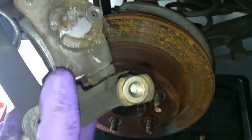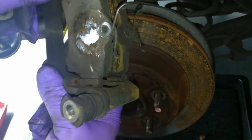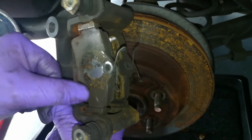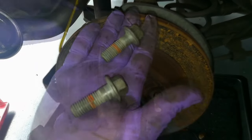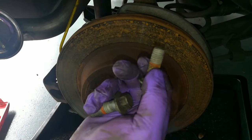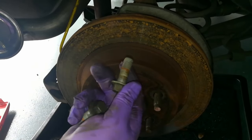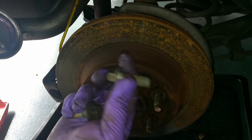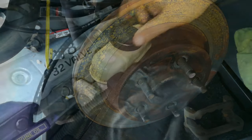You can see that each one of the brake pads back here actually has the hardware attached on the upper side and the lower side, so you want to make sure you put this back in the same exact orientation. Here are your bolts that hold the caliper bracket in place. If you're not very familiar with this or haven't done too many brake jobs, I recommend using blue loctite on here — it does a really good job. Look up the torque specs as well.